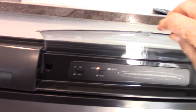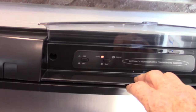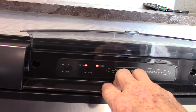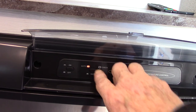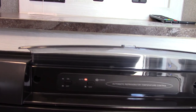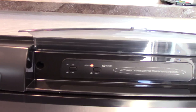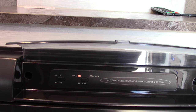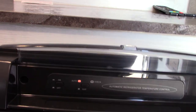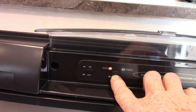Your refrigerator is a gas absorption refrigerator — it runs on either 110 AC or LP gas. To turn it on and off is just this button. Then you select your source, which is auto. Auto means electric — the reason they call it auto is because it automatically seeks out electricity, and if it can't find it, it will automatically switch over to LP gas. If you're out adventuring on a hot day and the campground power goes out, it'll sense that and automatically switch to gas so you don't spoil your food.